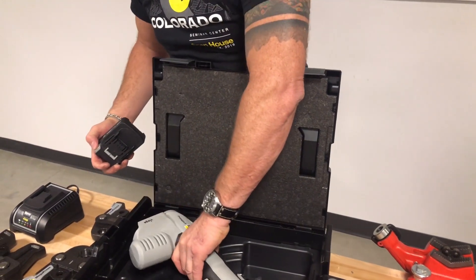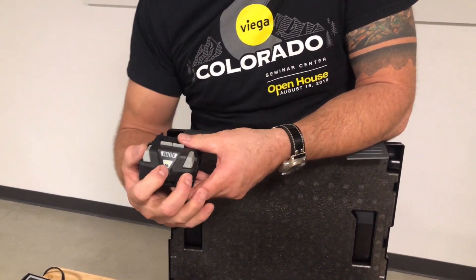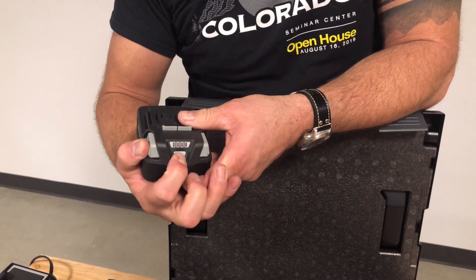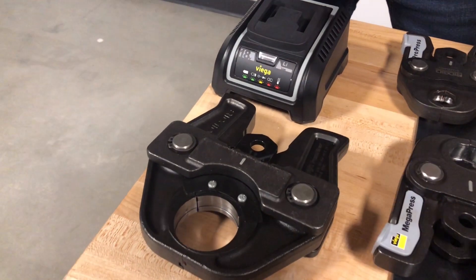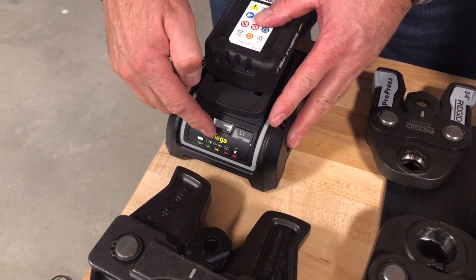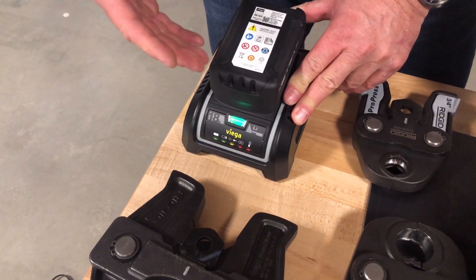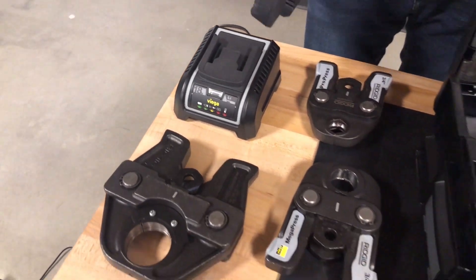On the battery platform, what's really cool is it's a 2.5-amp-hour battery with a built-in level indicator showing four sections: 25%, 50%, 75%, and 100% battery charge. For the battery charger, you can charge it with 120-volt AC or 12-volt in your truck. When you put the battery into the charger and power it up, it's going to flash amber, telling you you have power and it's ready to accept the battery. When you put the battery in, it will pulse green when it is charging, and then switch to a solid green when the battery is fully charged. Really cool system.